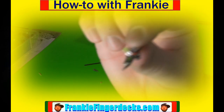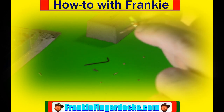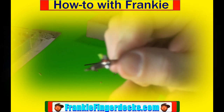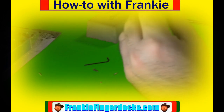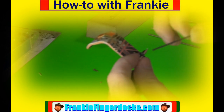So then you got the pivot cup put on, you have the top washer, top bushing, then on the other side of the hanger you have the bottom bushing. Then you're ready for the bottom washer. So then you got your whole hanger put together. Now you just need to put it on the base plate. Make sure your pivot cup goes down in the hole and your pin is lined up with your new thread hole that you just cut out with the pin.